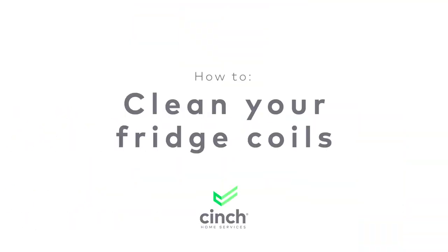When it comes to my favorite appliance in the house — the fridge — I'll do what I can to keep it in working order because that's where all the good stuff is. That's why today I'm going to show you how to clean your fridge coils. Regular refrigerator maintenance involves vacuuming the condenser coils on the back or the bottom to clear out the dust and gunk about twice a year.